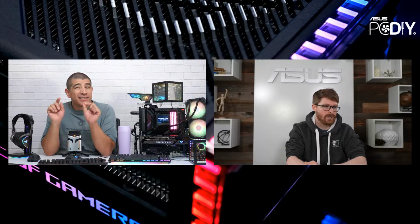Are you going to try maybe the OC button on GPU Tweak? Absolutely. It was one click and free FPS. And I want to highlight that, while you only gained 3 average FPS, the minimum actually jumped up quite a bit, and the maximum frame time actually dropped from 25 to 17, which is a pretty big difference. So yeah, some of that's not always about average. Yeah, sometimes that can also be from the initial caching.